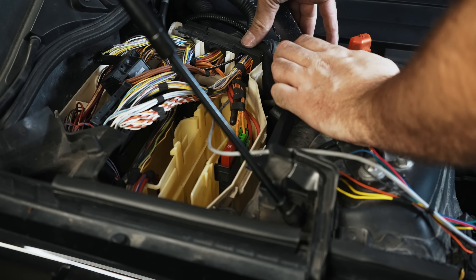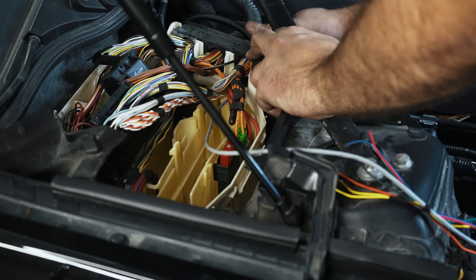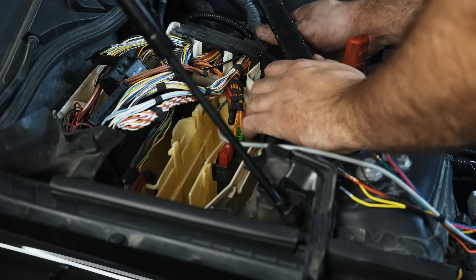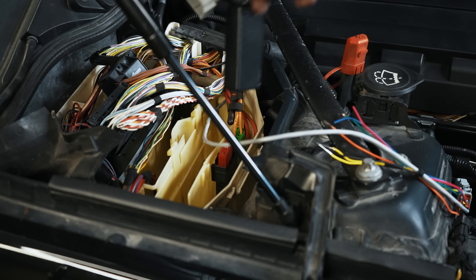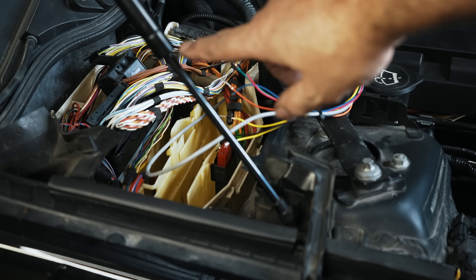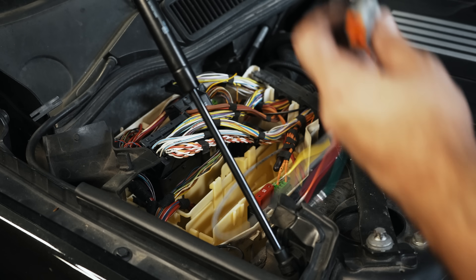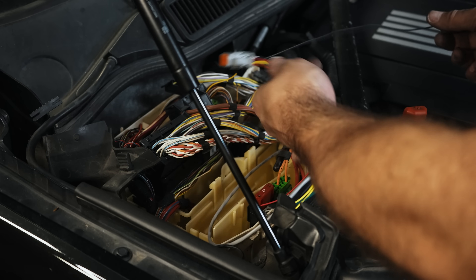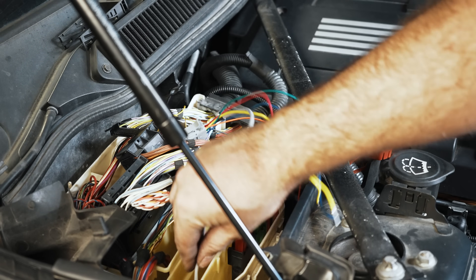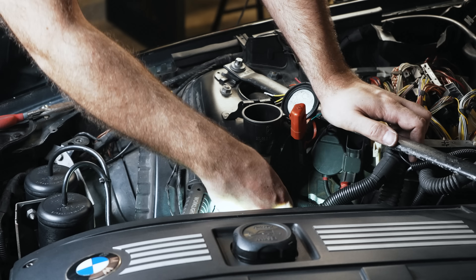I lifted up on the grommet, passed the wire through, and with the pressure of the ECU lid being on it will give some weather protection. There are cleaner ways to do it by making holes, but I've had success with this approach. The module just lives inside your ECU box. Now we have our connectors and need to merge them — cutting the zip tie that came with it since we need ground from outside the ECU box, so I'm passing the ground wire out through here.